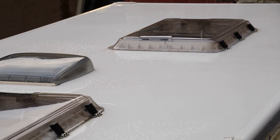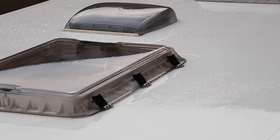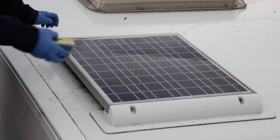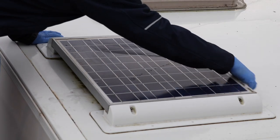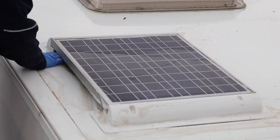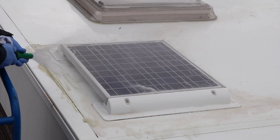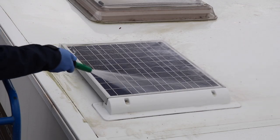To dry the roof you can use a squeegee. Use this to soak up as much water as you can, then wring out and repeat the process. For items such as solar panels, it's important to keep these as clean as you can — this will maximize the charge the panel can create to put back into your leisure battery whilst in storage.